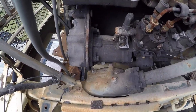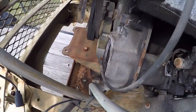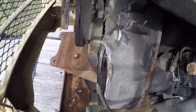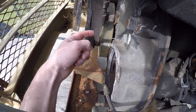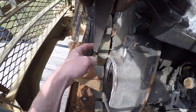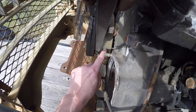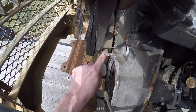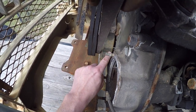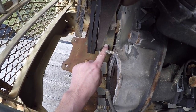Okay, so we're getting set up. Some of the first things that the old destruction manual says is to put it at top dead center number 1. So if you can see down here, let me see if I get my little finger pointer in here. Right there is a little pointer, and right here is a line, and actually there's several lines, but according to the instructions, it says that this is an LDS 465-1 or 1A. Anyway, there's 3 lines. I put it on the first line because this is actually a 1 delta.